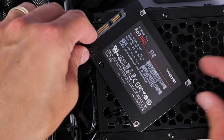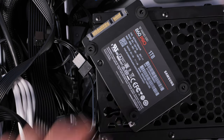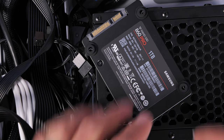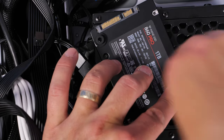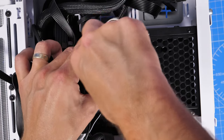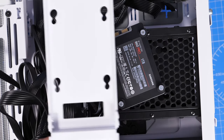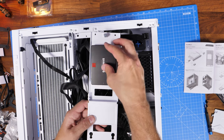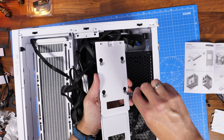If you're using a cooler with a display on it you probably don't want to buy that vertical GPU bracket — so I've now wasted money, which is annoying. Hopefully that'll be useful to you. Another point is if you're also doing what I'm doing with a Hyper-M2 card that usually sits in the bottom x16 slot, it's nearly blocking the fans as well, so there's not that much space at the bottom. For SSD mounting and hard disk drives you have various different points — I'd recommend checking out the link in the description to the official Lian Li page on this case because there are various places you can mount drives.